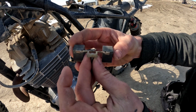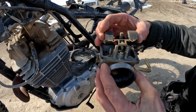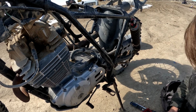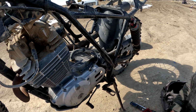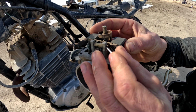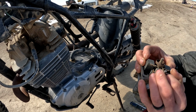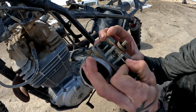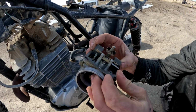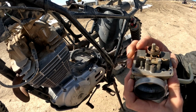We're just going to hang the needle on the float, and then slide it on down into the seat assembly. I'm going to slide the pin back in. Yeah, come on. Yeah, this is always such a nightmare. And the wind doesn't help either. Okay, there we go. Got her inserted and seated all the way down.